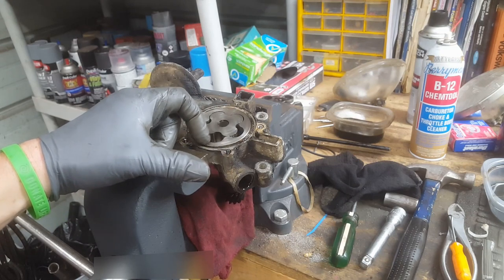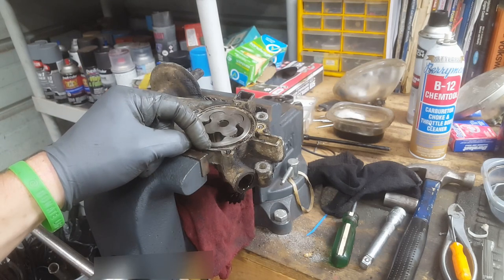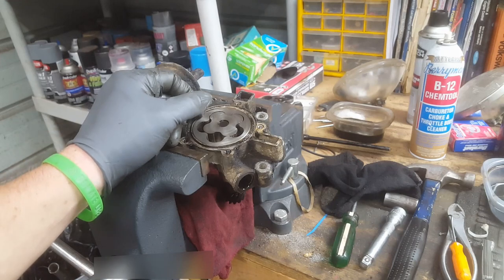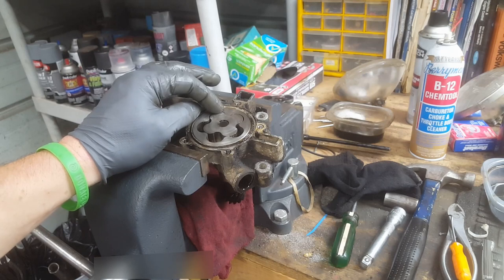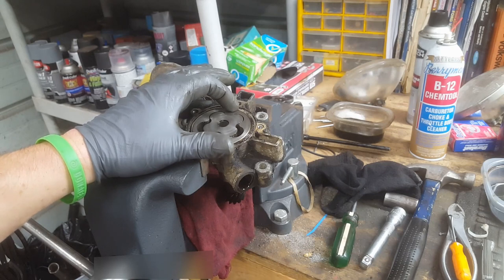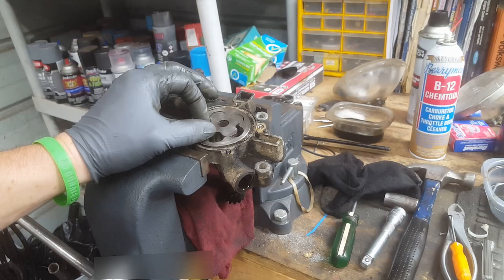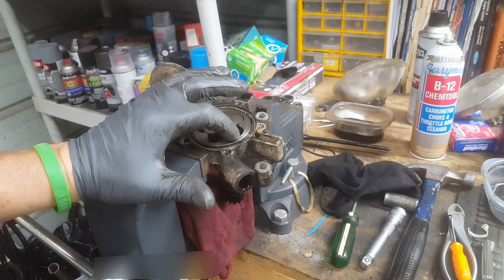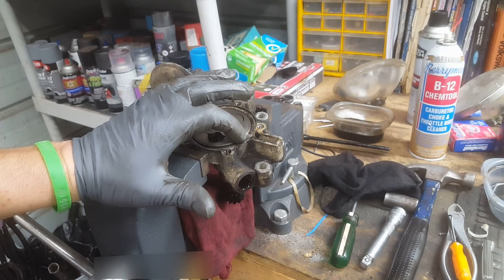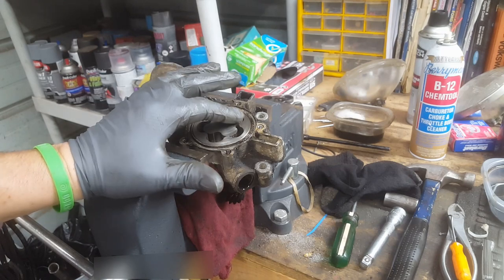That's probably why, you know, the O-ring was in terrible shape, but assuming the oil pump never had been apart, I'm confident of that, it looks original, then probably the main reason that it started to leak is not totally due to the fact that the O-ring seal was petrified. It was. But probably this thing started getting these grooves in it, and it started passing. You can see there's a lot of discoloration right here, right behind where that O-ring goes. And so it's probably just starting to push more oil.